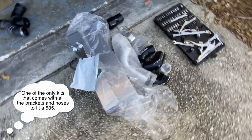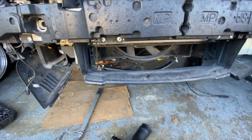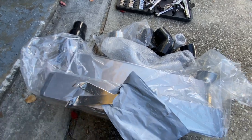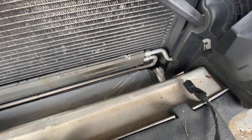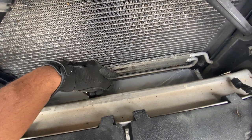It's a 7.5 so it will pretty much do the job for this install. I gotta trim off all this stuff, make room for it, and have the brackets to make sure it fits correctly. I have the intercooler marked up — everything fits pretty good. This is a manual car so I don't have the other cooler line to worry about rerouting.